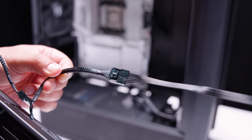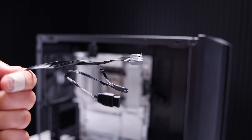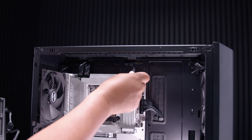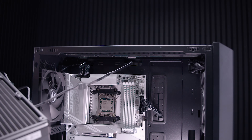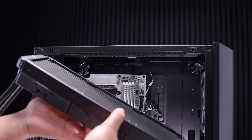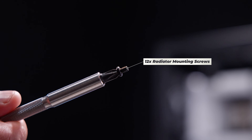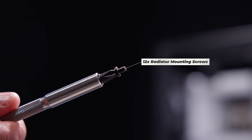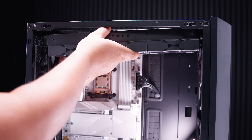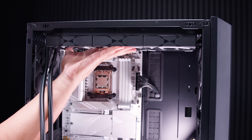Plug them in and clip them into place — it'll make a nice little clipping sound when you do this. Feed the other end of the cables — which includes a PWM connector and two RGB connectors — through to the back side of your case. This makes cable management nicer and it makes it easier to install your radiator. Locate 12 of the mounting screws to mount the radiator to the case itself. Depending on the case, it can be different to install the radiator. This case has a removable top, but you can maneuver the radiator to fit in without removing the top bracket.